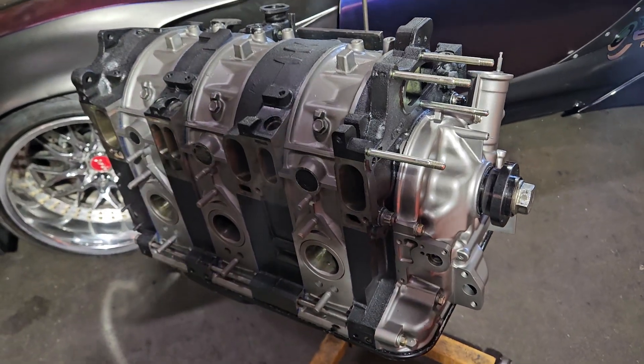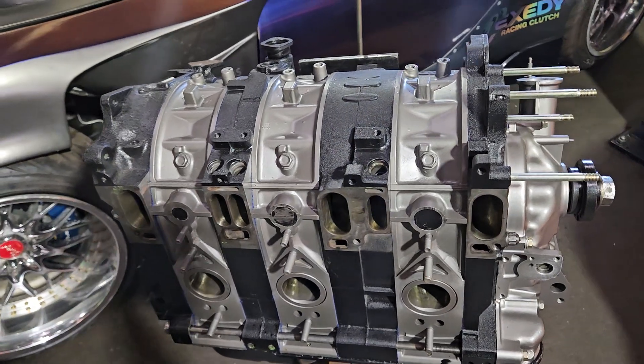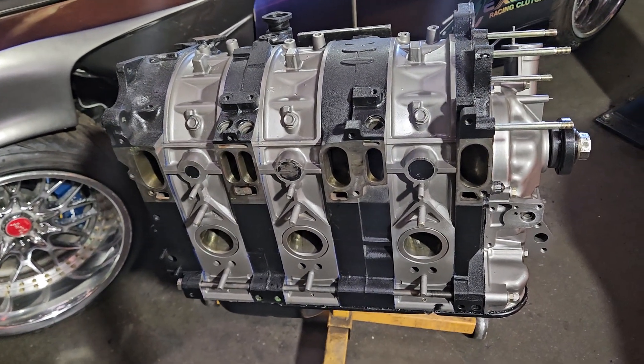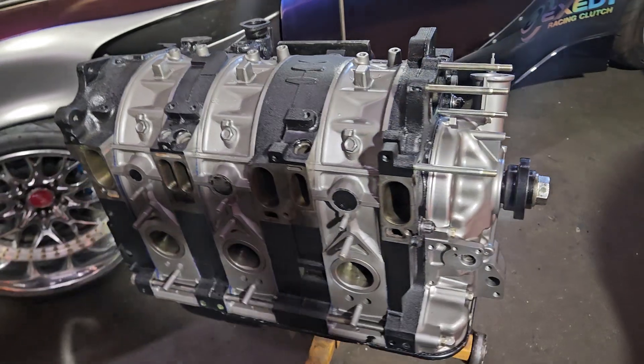Along with that, it's been swapped to ENJ 2mm 2-piece apex seals. That way you're ensuring that your rotors, your turbo, your rotor housings are a lot safer. If anything were to go wrong when you're running high boost, nitrous, anything like that — a lot more protection with some of those aftermarket racing style seals.